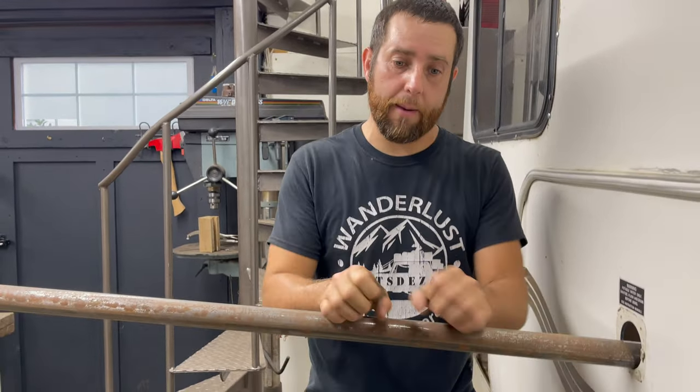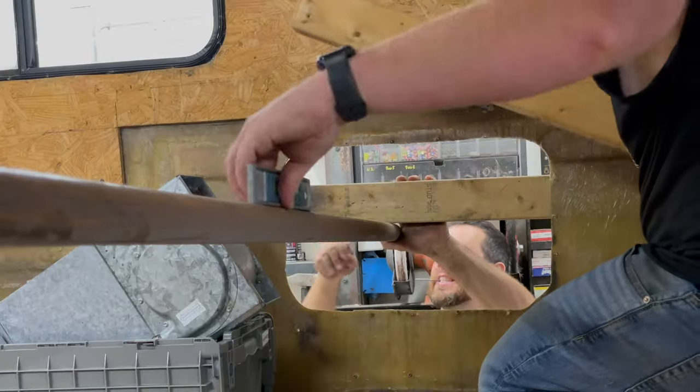We've come up with a much safer and better way to do this. We're gonna put this pipe clean through it, level the pipe so that the camper back's completely level, and then tack weld this pipe to the lift so it can't possibly move. And by doing that, we're making a square, solid lift point that can't change when it lifts. This is very floppy, because there's no supports in it right now. They're actually framed kind of like a house. So this will be the safest way to pick this up straight without breaking it. We're gonna sandwich it.